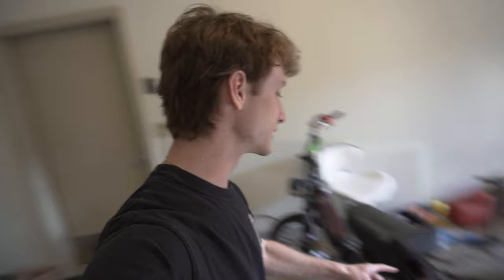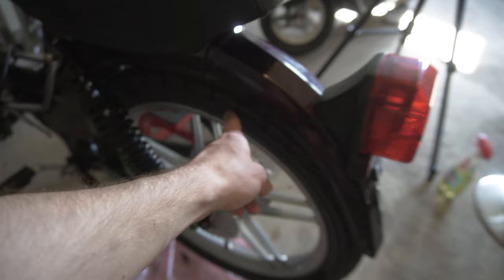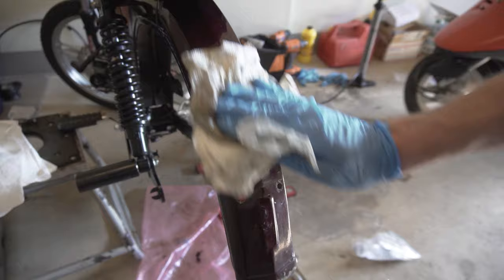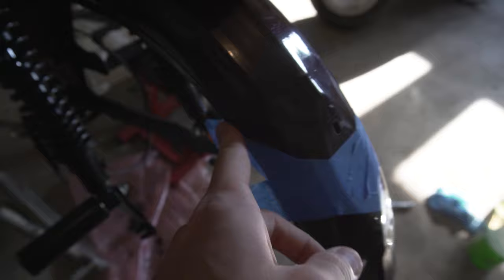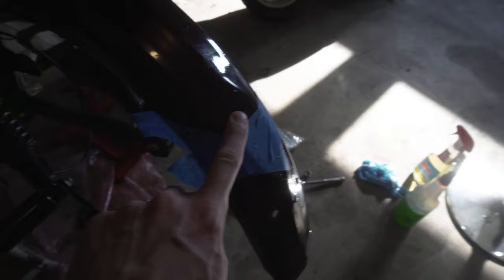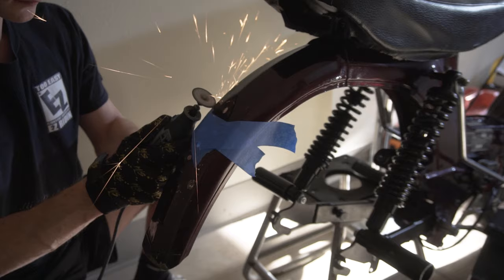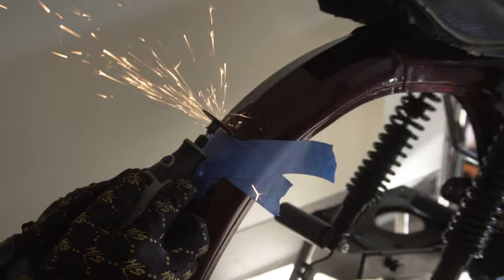The wheel still didn't have enough clearance. One of the most popular things people do when they start to mod these mopeds is cut the rear fender. I mocked up where I want to cut — along the top of this line here — making sure to leave the bolt hole so I still have a mounting point for the tail light. If you're cutting anything, you want to use protection; shout out to Detour Sunglasses for the safety goggles — link in the description.